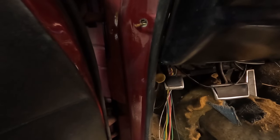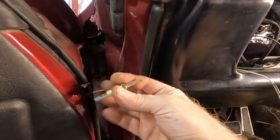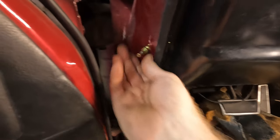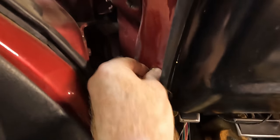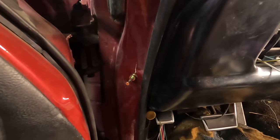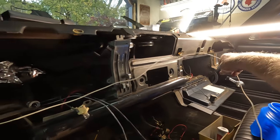My suggestion would not be to put the door jamb switch in first — it would be to bring your wires out, connect it to the new door jamb switch, and then put it back in that way. We just use a 7/16th to get that tightened back up, and now we've got a brand new door switch. The wiring is old, but I didn't have those terminals — there are some really super small terminals — so I use those and then I can run this wire across to the other side and repeat it over there.